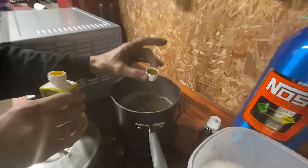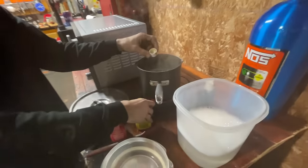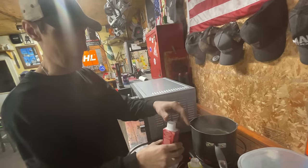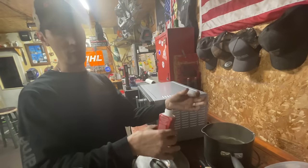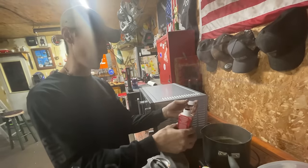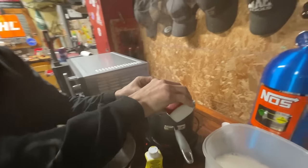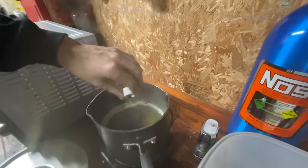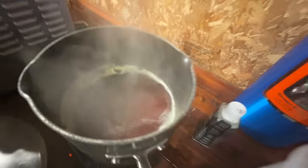The dye bath may look brown but that's just how this dye works. You want your dye bath way lighter than the color you're trying to end up with — you want the dye to get into the plastics very well. If you start getting too dark on your color you have to pull it out and you're done — it's going to turn way too dark. Eventually pretty much every color you do will turn black. This is going to be about a third red since orange is a lot of yellow, very little red.